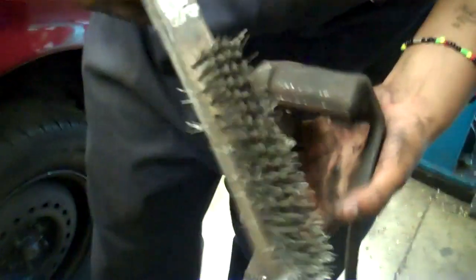I still have to do the other side of this car. When you get in the car, don't just expect to drive away. Before you even get in the car, pump the brakes to the bottom and do it until it becomes firm, because as of right now there's going to be no pressure there.